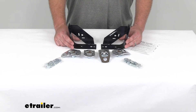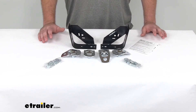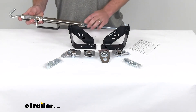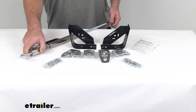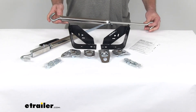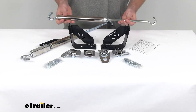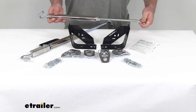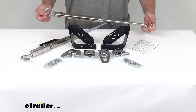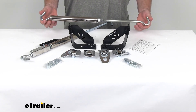When you're looking at this, it's important to think about how you are going to attach your camper to your tie-downs. If you don't already have an option, Happy Jack does have two different styles of turnbuckles. These are very simple devices — one hook attaches to your camper, the other hook attaches to your tie-downs, and the turnbuckle allows it to spin independently so you can tighten it down. This is the original turnbuckle from Happy Jack, and you can find it here at eTrailer using part number LC182898.